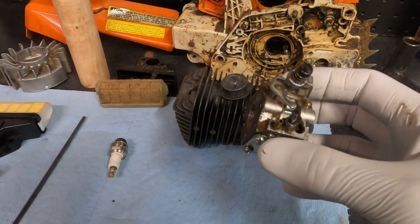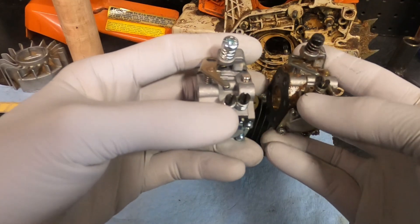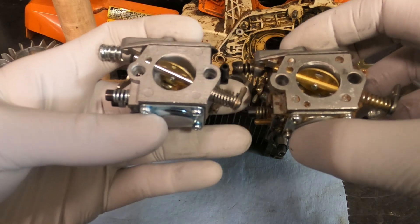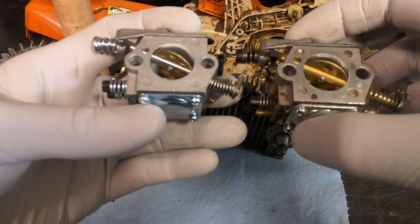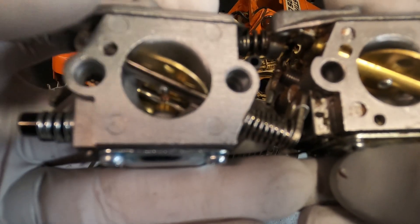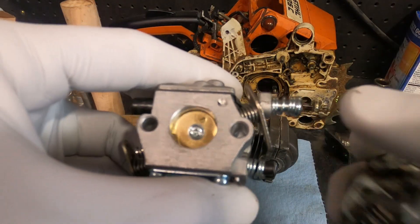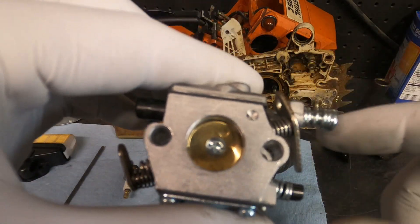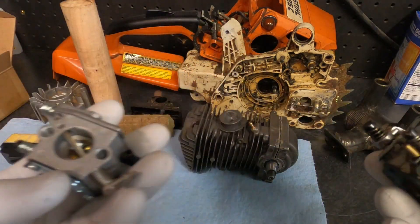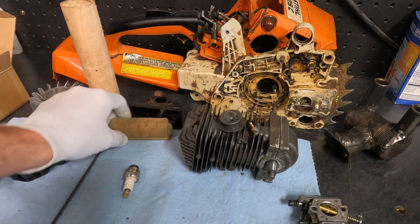It was only low-side adjustable. I have ordered a new aftermarket carburetor off eBay with low and high side, and I lose the primer bubble — that's fine, I don't need it at all. Very similar throats, definitely not quite identical, but it should work for our needs. I do plan on shaving down the screw and shaft on the throttle blade and also the choke blade, just to give this the best opportunity to move adequate volumes of air. I feel like we're starting to get to the point where this motor is going to be moving more air than the original O25 was.